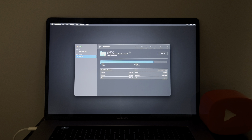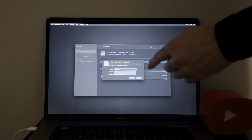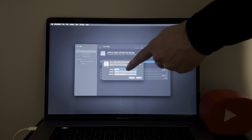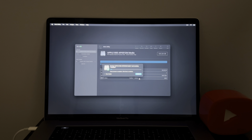As you can see, because I used Command Option R, we have the latest Mac OS Sequoia. Go to Disk Utility and continue. When it says View, you want to Show All Devices. Select the top one top-left, then click Erase. You've got Untitled, APFS, GUID Partition Map. You can change the name if you want, but don't change the format or the scheme — leave them as they are. Go ahead and erase the partition.